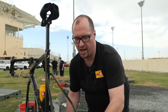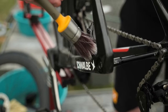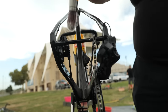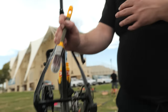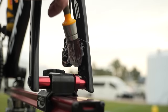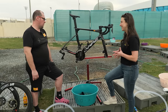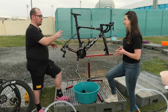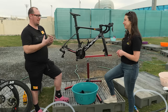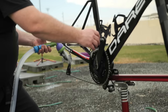After finishing cleaning the chain, just a little bit more degreaser, and a bit that often gets missed is where the brake dust gathers underneath the caliper. Some people may worry about degreaser on the pads, but by the time we've washed it off and dried it, everything is going to work absolutely fine. How long do you need to leave the degreaser on to marinate? With a pro bike, by the time you've gone around and put the degreaser on, it should be ready to come straight off. For someone at home where they haven't cleaned the bike so often, maybe five to ten minutes — by the time you've done that, it should be ready to rinse off.